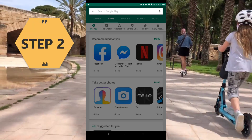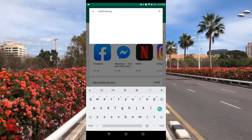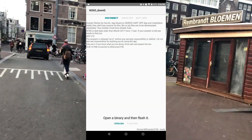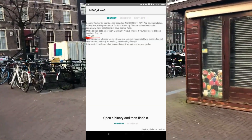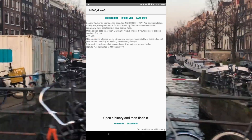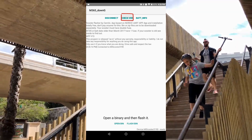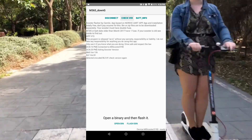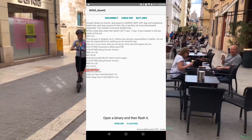Step 2: Download the M365 DownG app from the Play Store to your Android device. Connect to your scooter and be sure you have at least version 1.3 of the application. Press the check version button, and if you follow the instructions in the app, you might find that you need to press it again to see the actual firmware version currently running on your scooter.